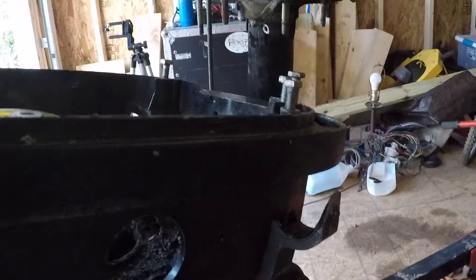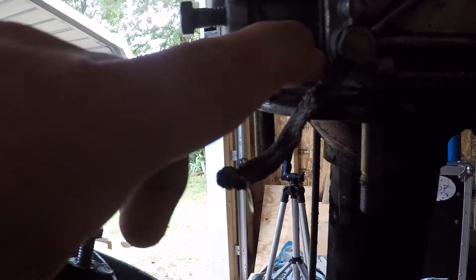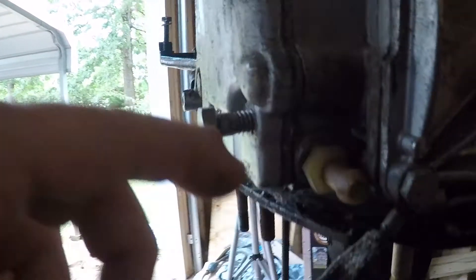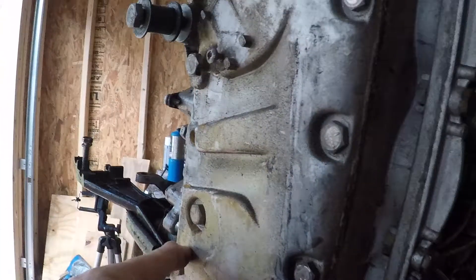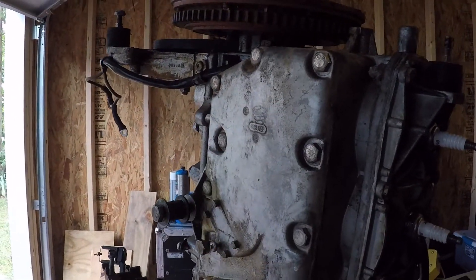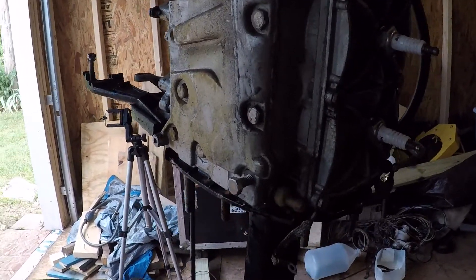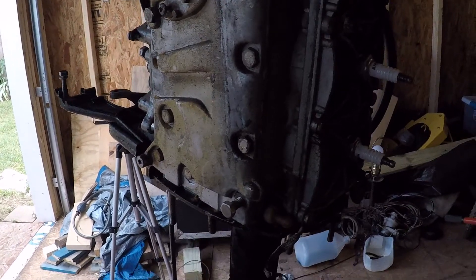The lower unit's in great condition and I'll open it up and check it out. This here is the water inlet, and as you can see it's really badly clogged, which means inside here there's a water cavity. That cavity basically comes up and goes back out here, and that's how it cools the power head. I have one gasket and I'm going to have to order another — I'll look up that part number and get it ordered.